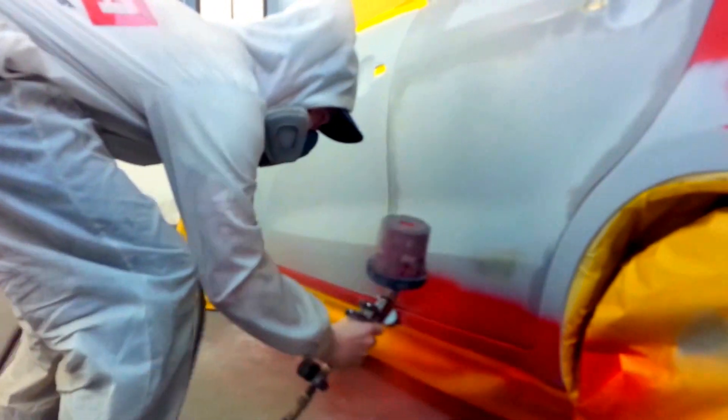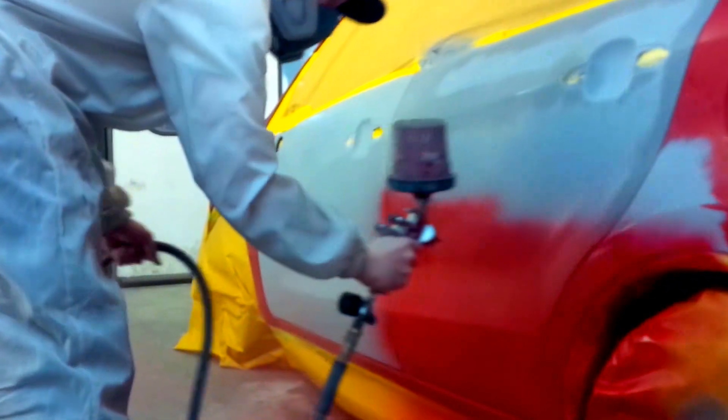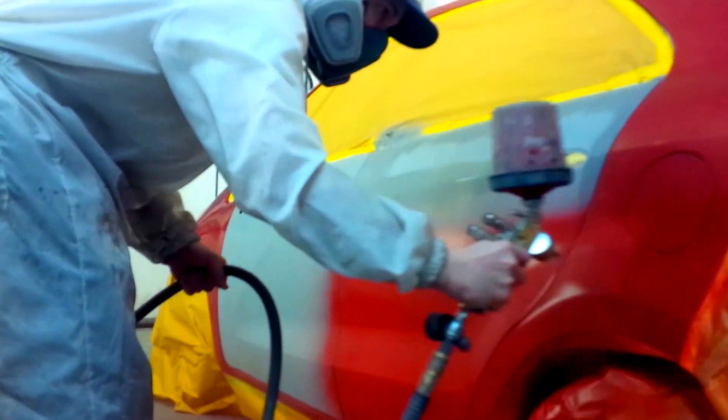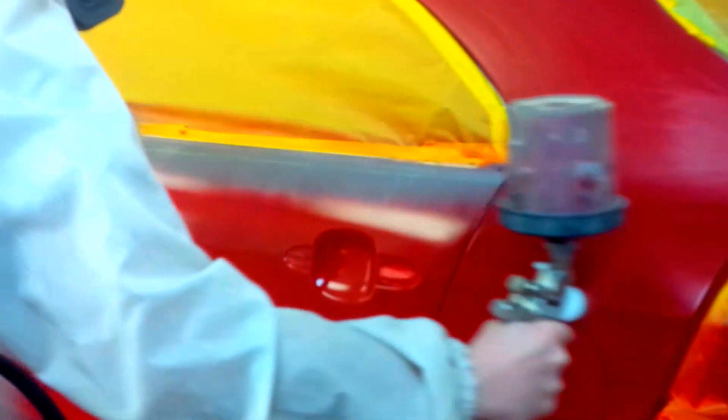He hasn't been spraying for a very long time, so there's a lot to look at with his spray technique. For starters, you'll see a lot of the time he's doing a dead stop as he comes to the edge of his spray. Sometimes he rolls his wrist a little, and that's the way you want to do it — you want to make sure that you're moving your paint out and not having a big hard edge when you stop, because if you stop at the edge and come back immediately you're going to start to pile up material on that edge. I personally like to walk the entire length of a car on a small job like this. You can see the line he's following is a little bit crooked, but the paint's pretty forgiving and as the years go on I'm sure it'll look a little bit more robotic.